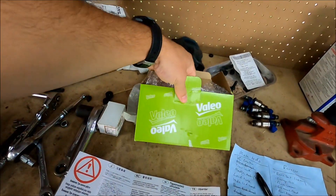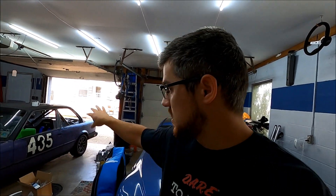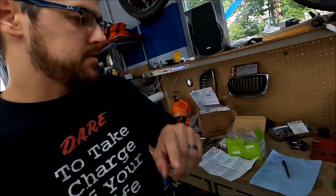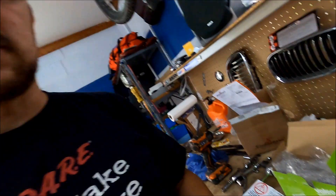We're going to jump right in. The first thing we're going to do is the fuel pump. We've got a replacement fuel pump here. At one of the previous races, an AutoZone pump got put in there that didn't quite have the flow capacity that a proper E30 should have, so it was cutting out after it got hot at high RPM. We're going to stick a new one in — hopefully that will sort that out. One other thing I forgot to add to the list: re-boot the axles. One of the axles is torn, so we're going to pop it out, put a new boot on it, pack it full of grease.